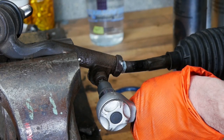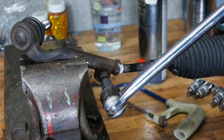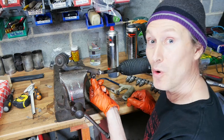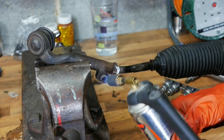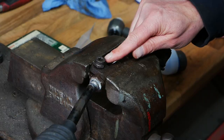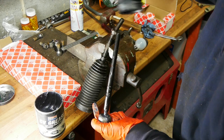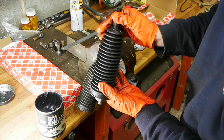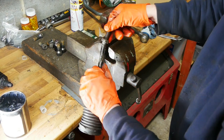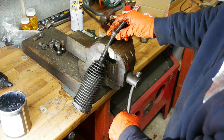My plan was to reuse the outer track rod with the ball joint on it, so I was trying to get it undone off the inner - oh geez, that's tight. I put quite a lot of force on it and I really don't want to strip that out. In the end, despite my best efforts, unfortunately to no avail and I sheared it off. I could have drilled it out, re-tapped, and done all that, but I'm quite happy to put a new one on - it only cost 25 quid, so it didn't seem worth messing around. I bought a new bellows because my old one was split, so I'm just going to pop that on now because I won't be able to get it on later. Even though I bought a new outer and inner tie rod, neither one came with a new lock nut, so I'm just going to remove this one so I can use it again.